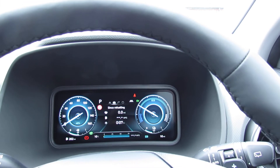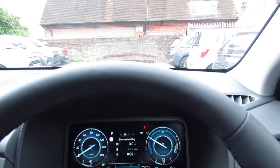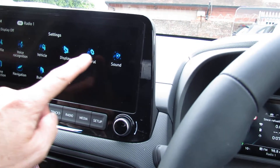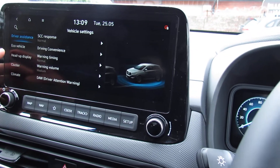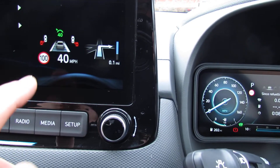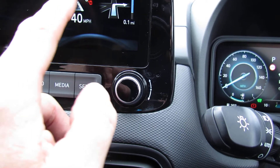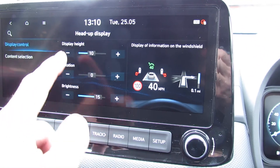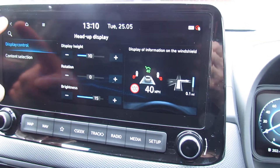It is dependent on your own driving seating position, so where you need to see the display may be different from where another driver would have it. If I turn the media unit on and press set up, it gives a whole host of information. Look for vehicle, and then you can see heads-up display — press that and that's the kind of information you'd see on screen. If sat-nav is on, it's telling you where to go, the speed of the road, the speed you're doing, whether there's a car on the inside or outside, and you can also set your speed limiter and cruise control. You press display content and you can rotate it; display height so it sits in your eye line, you can twist it, and you can change the brightness as well.